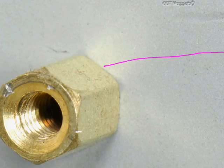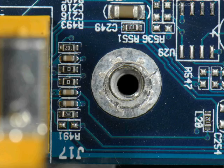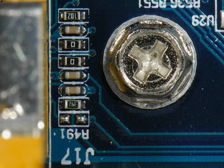So then what we would do is screw our motherboard screws through the motherboard and into this standoff that we see here. That's what those threads are. When you look at the motherboard itself, and I'm looking at just one portion of it right here, you can see the screw hole where we would take our screw and plop it down in there. Underneath this, at the bottom, would be the brass standoff that would be threaded for this screw. Then you would just take the screw and screw it in. Not too hard to figure out. Just righty-tighty, lefty-loosey. Okay, and that's pretty much it.